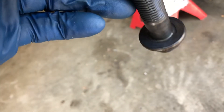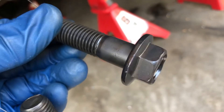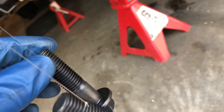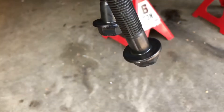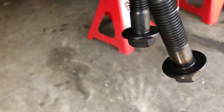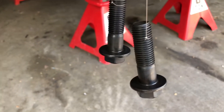Now it's supposed to be completely dry enough to touch and use after about 10 minutes, but I'm just going to take an extra precaution. This is the one I did about an hour ago — it does look a little bit smoother as far as the coating. I'm going to let these sit here for a while. And like I said, if you mess up, it doesn't look right — there are different types of steel that will turn easier than others. Some you have to dip for five or ten minutes, or dip and dry and dip again. You just kind of have to use some trial and error. If it messes up, you just re-dip it in muriatic acid, let it sit for half an hour, and start the process over again. When you're starting from rusted bolts, you really can't do any harm.